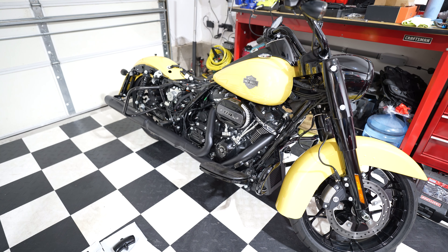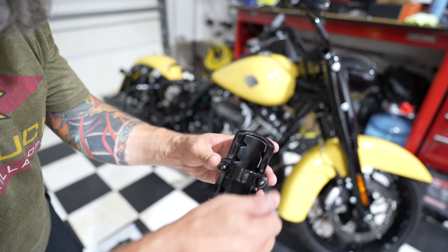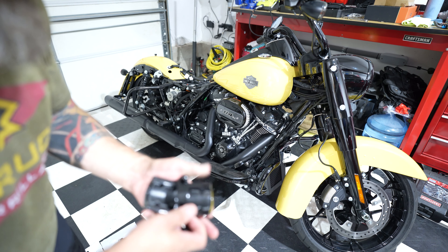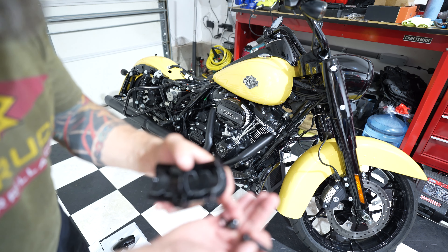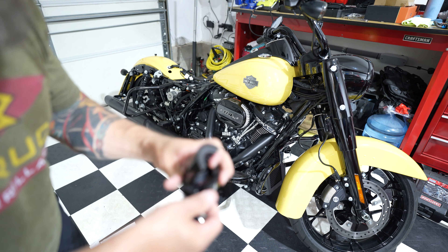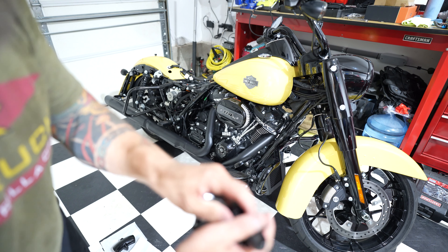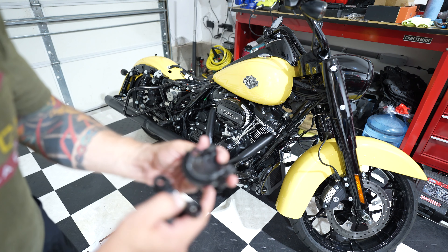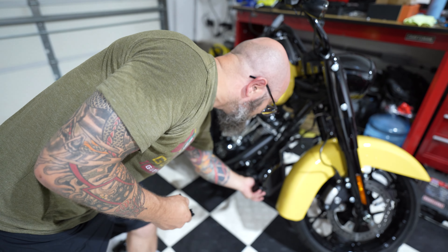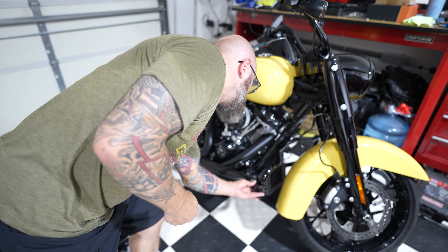Let's go ahead and install the drop guards. Let's start with the front. Basically what you have here is a bolt, a lock nut, and the same thing on the other side. You also have a rubber gasket so you don't get it scratched up, and a small rubber gasket on the other side as well. The drop guard is not going to go completely on the bottom — because if the bike drops it's actually going to land right around this area. So play around a little bit with the location; it should be more along the lines of here, not on the very bottom.